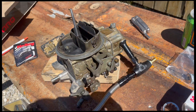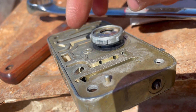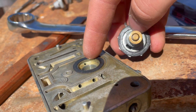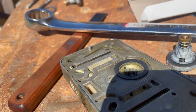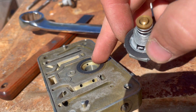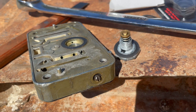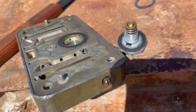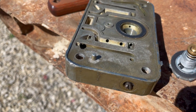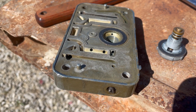I'm going to go take this primary bowl off and get that power valve swapped out as well. Here's a great example of what I was talking about — the gasket here splits whenever you take it apart. There's half of it there, half of it there. It's not because there are two gaskets — they get delaminated, so it should be one gasket and it's now two. If you try to only use one, it's not going to work, so you have to use a new one when you install power valves — it seems like every time. That's why I bought a pack of ten. They're pretty affordable, and I'd highly recommend doing that; you really don't want your power valves leaking.